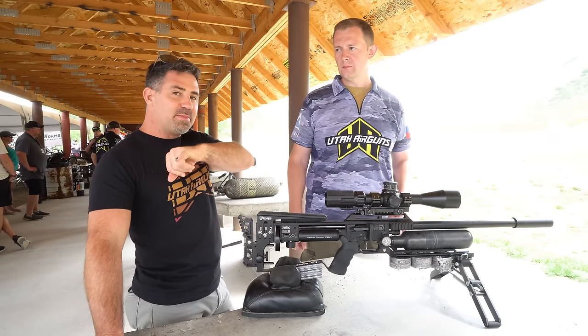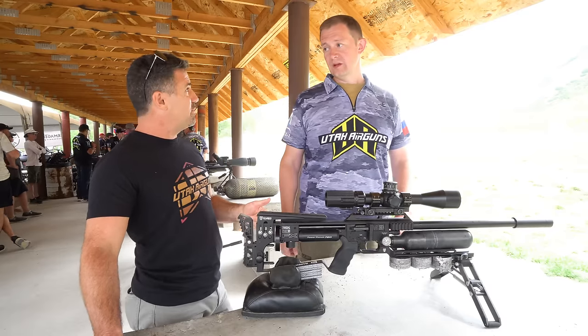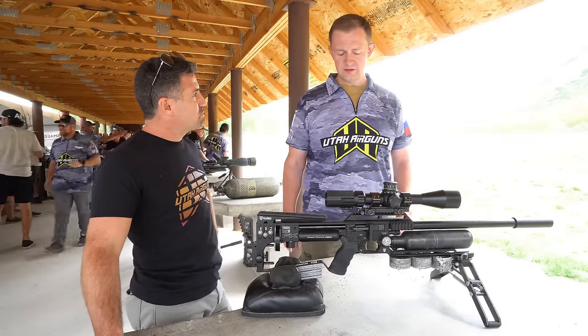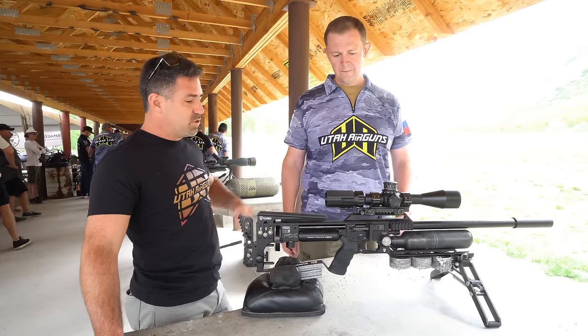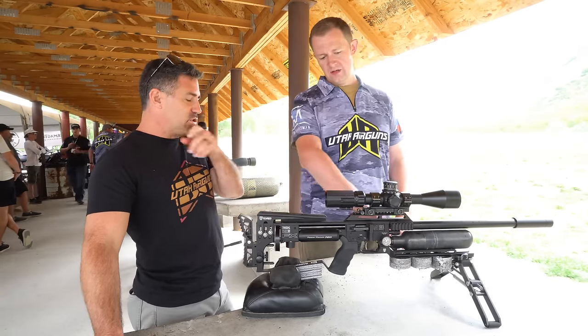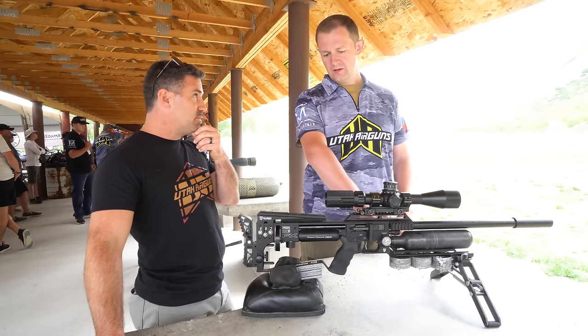We just talked about it in the Maverick video. A 30 to 40 bar difference is ideal, but you opened it up. Interesting. In our case, it gave the best result. We tried different setups. So 140 on the back, wide open on the front, and then minimum tension on the valve.